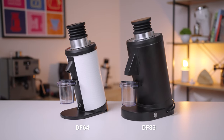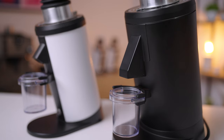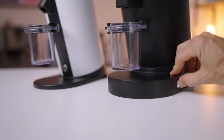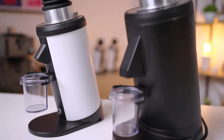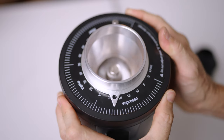These design improvements from the DF-64 include no longer a vinyl-wrapped aluminium body — the body of the DF-83 is a high-quality metal body, painted black or white. The grinder's button has moved from underneath the catch cup to around the side on a thicker base for better stability, although the grinder does still spin a lot under that torque when turned on. You also have a longer grinds chute extending closer down towards the catch cup, and now an adjustment indicator which is removable — used to be an aftermarket part but now ships standard on all DF-83 grinders.